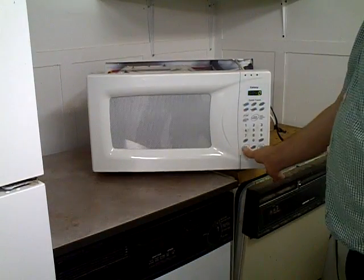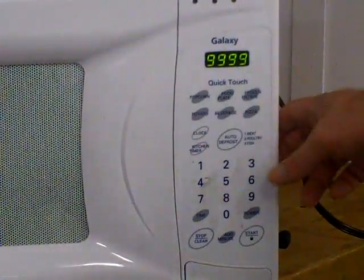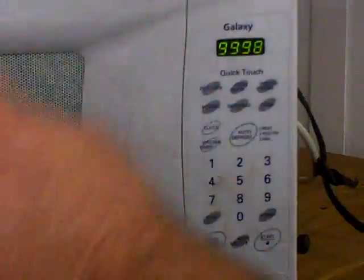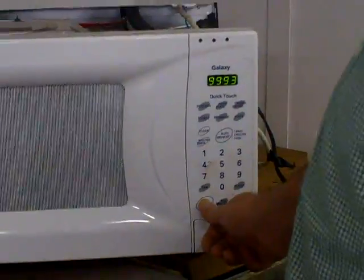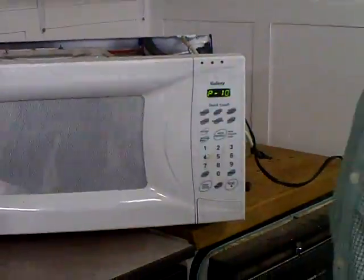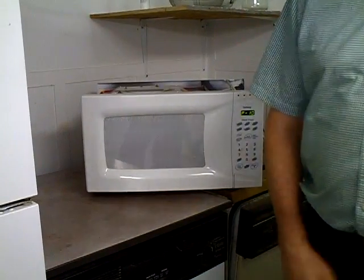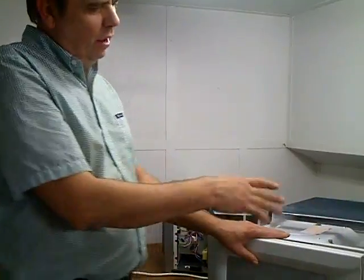You simply put the water in, press the clear button, then set 99 minutes and 99 seconds at power level 2 for the first run and hit start. Let it run for 99 minutes, and later after it's cooled off, run it again — 99 minutes at power level 1. When those two cycles are done, the water would usually be up to 10 or 11 parts per million. You only have to run two cycles on the semi-automatic, whereas the manual one you may run the water through 5, 10, or 15 times — usually about 5 to 10 times, depending on the size of the pitcher.